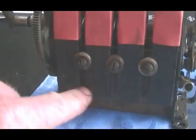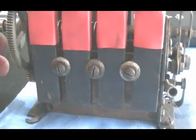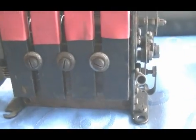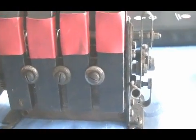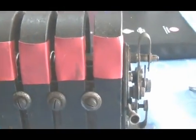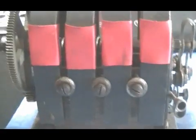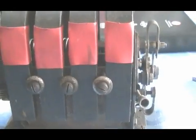Your magnet strength doesn't have a lot to do with it, because the machine builds up its own magnetic field once the points are closed and the coil is shorted, just like any generator. When those points open, we get our high voltage surge from the coil as the magnetic field collapses around it. So I'll post this on the forum — 300 plus ohms on the coil, so you do have some winding to do if you're going to rewind them. Alright, cheers from the tin man.